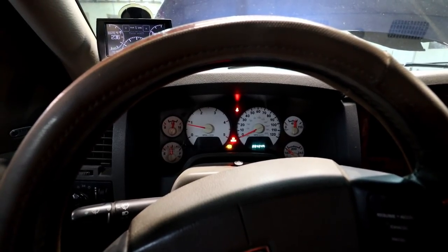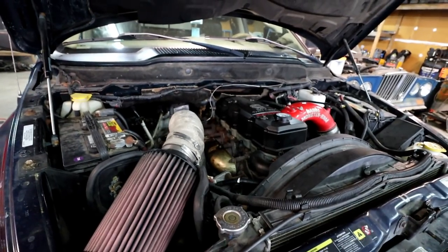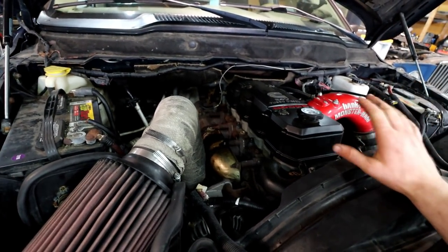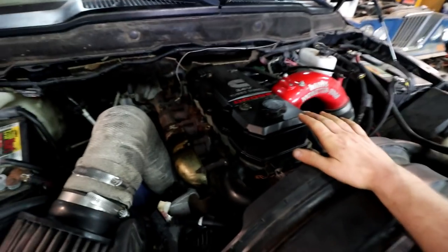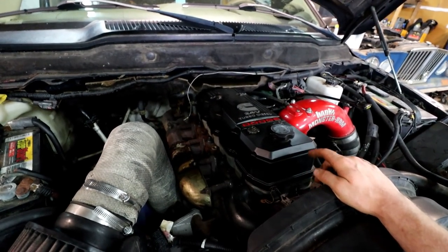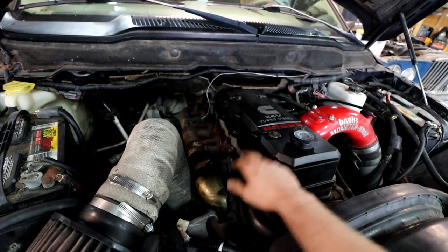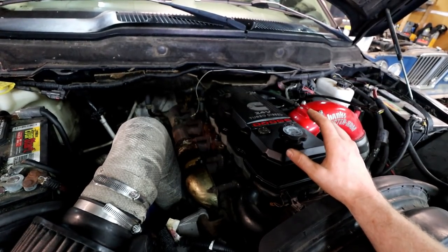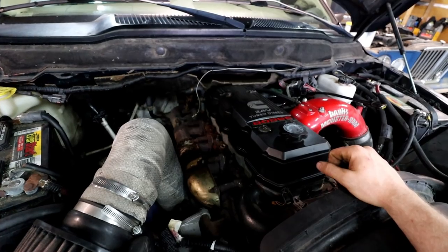Now that we know it works, I'm going to drive it around and incrementally turn up the boost. I've been driving around for about a week and everything's been running and driving perfectly — no signs of head gasket failure. Mission success. I'm going to go ahead and change out the oil. This might not be necessary, but when you're using anti-seize like they give you for the head bolts it probably has no harm, but I still feel better flushing it out and starting fresh.